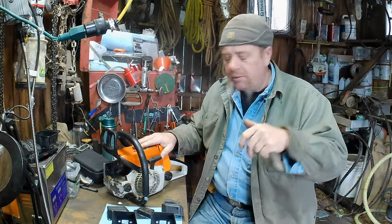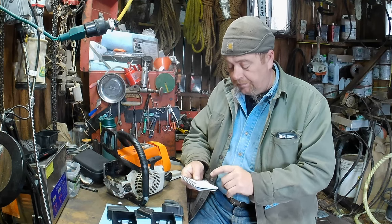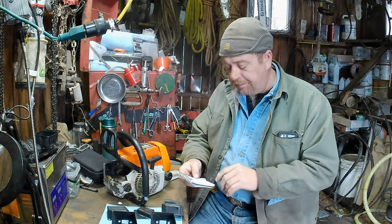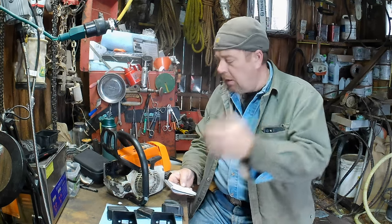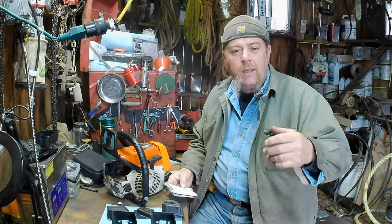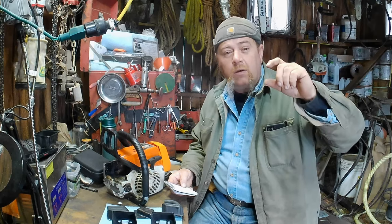Speaking of the build, I'll put the current timing numbers in the description below. We've still got an air filter mod, ignition timing, and we need to decide if we want to change the timing from what the current numbers are. The intake could be a little longer for sure. We're going to see if we want to do any machine work — maybe save that last for people that don't have machine work capabilities. We might cut the squish and cut the base to build compression a little more, which in turn will lower our exhaust a little bit.